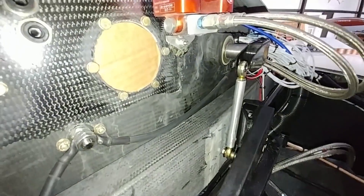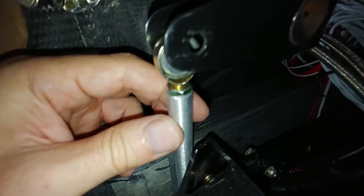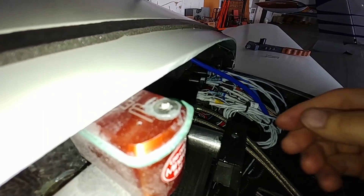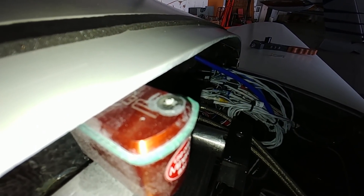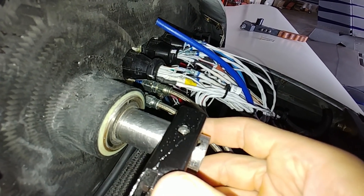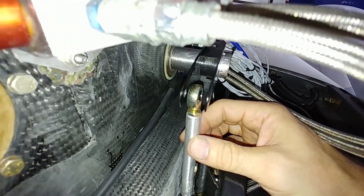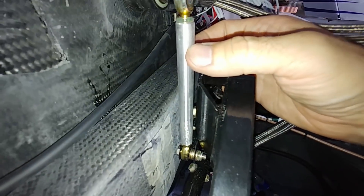That's basically all of them done. Next up, Justin and Elliot wanted me to create a bit more clearance between this rod here and that new bracket I created for the elevator counterweight. It was sort of just touching that bracket. What I've done now is I've moved — in the process of moving — this bell crank here back further in towards the bulkhead. I just drilled a second hole here, left it the same length, and can anchor it there. That basically moves everything aft a little bit, and once that's in place there's about an eighth of an inch of clearance here, so it doesn't touch anymore.